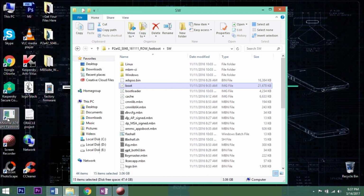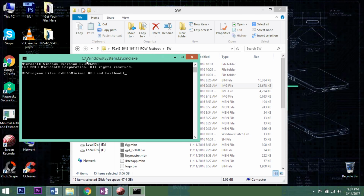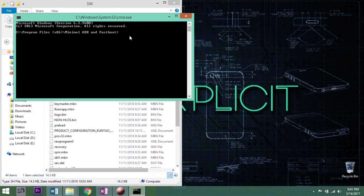So once it's restarted, boot it back to the Fastboot mode by pressing and holding the volume down and power button. Once you're in Fastboot mode, type the commands exactly as shown in the video. For your convenience, I'll put all the commands in the description section below and you can just copy paste them from there. Do not miss any of the commands as the restore would be left incomplete if you missed out on one of the parts.